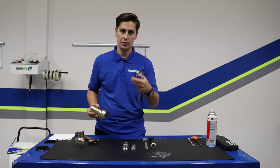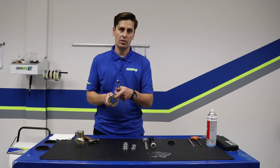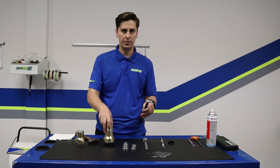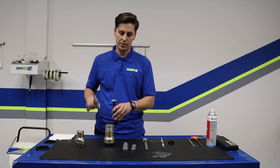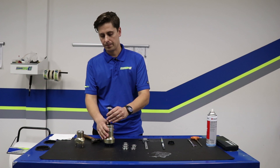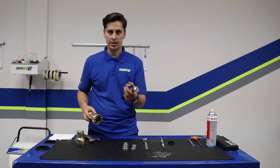Some hubs are actually even plastic and you can pull them out. Now that we have the centering ring removed, there's no interference in driving this bearing all the way out the front side. I'm going to use a special tool that sets inside the bearing — it's specially made for 25 and 17 millimeter bearings. We'll slide it right inside the hub and give it a good whack, and the bearing comes straight out.